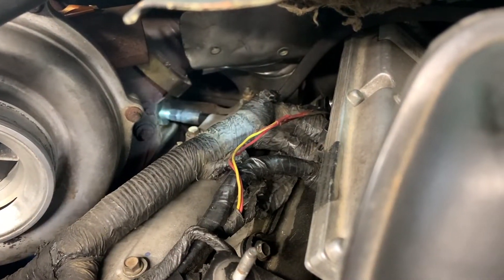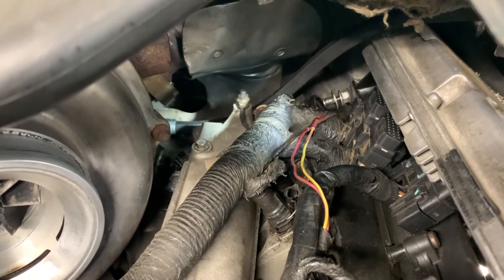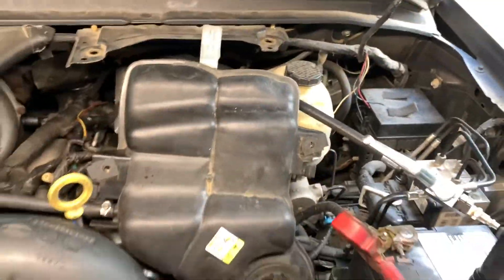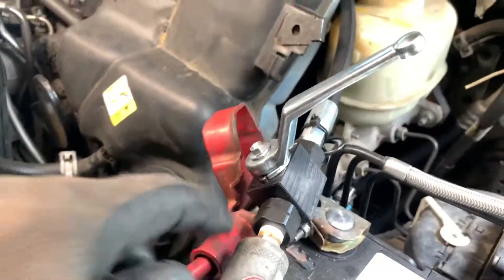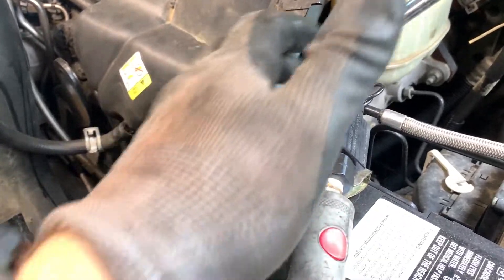We got the IPR air test tool screwed in — went in really easy. Ran the hose right there at the back of the intake, came over the FICM that's unbolted here, and I was able to just twist and thread it in real easy, kind of like doing a compression tester on a gas burner. So let's hook our air up — got shop air hooked up to it. This is a really nice valve, made in Germany. I actually took a male air plug off one of my other air tools that I know does not leak, because you don't want an air leak here confusing you while you're listening. Let's open this up and see what we got.